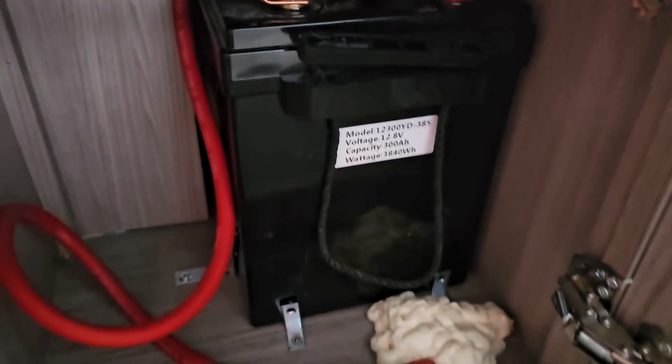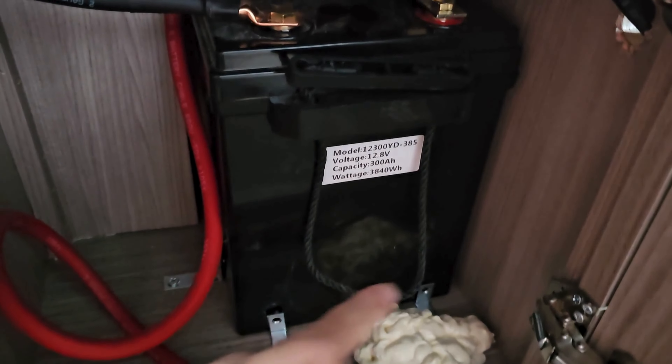The negative cable runs through the cabinet over to the next one, which is where our MasterVolt Combi system is as well as a negative bus bar. We put little brackets to keep the batteries in place while traveling, and we spray-foamed those holes too. The black cables run all the way through to the back and attach into our Balmar connector — it's dark and tight so hard to see, but that's it. Overall it was a very simple setup. In all, I'd say it was about a four-to-six hour project to go from 200 amp hours to 1200 amp hours. Our readings show we'd get about 10 hours on our AC on low at 68 degrees with our refrigerator and basic lights running — which is honestly our goal since we live in Texas.